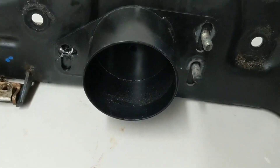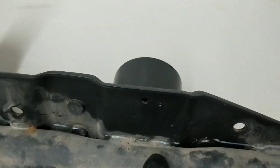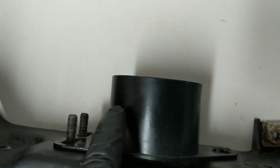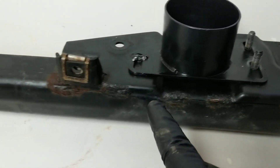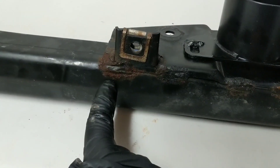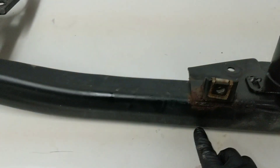Finally, I'm at the first mile marker on this part of the project — this is out. You can see that I snapped off one of the three bolts and it got tack welded into place. But I just realized I have a new challenge: the back side of these three bolts are just pressed into this piece, and then this piece was welded to the bottom with the core support. Meaning if I wanted to tap a new bolt in here, I actually can't reach it — the bottom of the integrated charge system is blocking its path. A better solution may be to just find a replacement lower core support entirely and remount the 034 snub mount bracket onto it. It's also disappointing to see how much rust was forming along the weld lines, because if this rust breaks through to the other side, that's a boost leak.